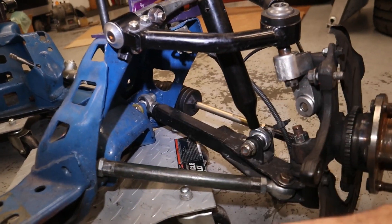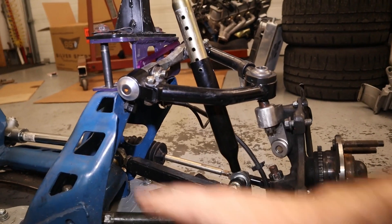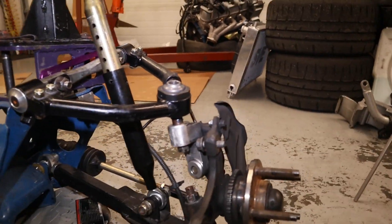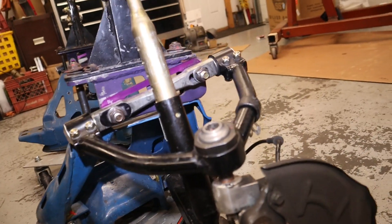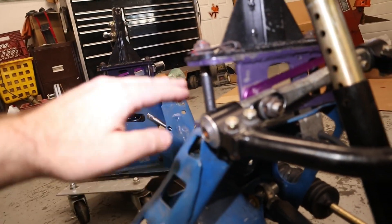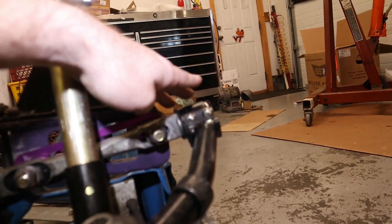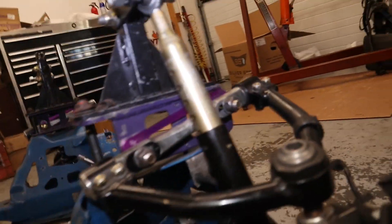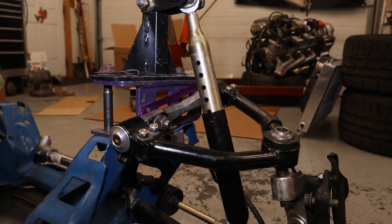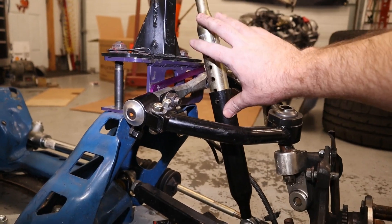The lower control arm goes in basically the factory location, and the upper arm has to be so short due to the frame rail that runs through here. With the angle I have in my upper arm, it's below where the frame rail would actually be, so we can't really cut into it there. The other hole is getting to the top of where the frame rail would be, so any pocketing of the frame rail would require removing a lot of the anti-dive — which is possible, but I'd probably need to run a little more spring.